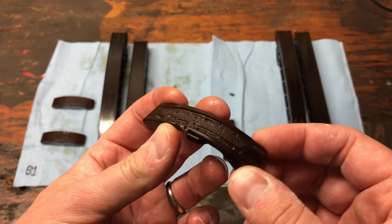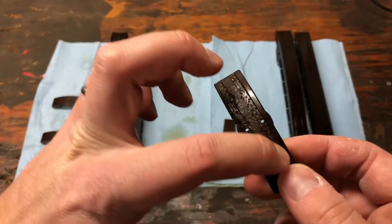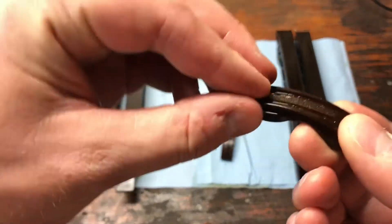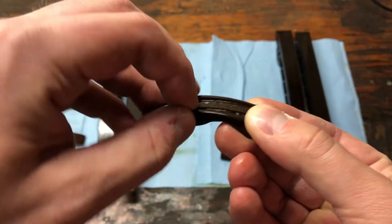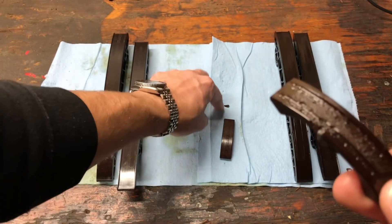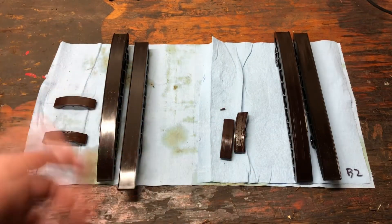There was some significant pitting going on here and this guide did not have much life left in it. It does make me wonder how much longer I could have run this before it would have completely disintegrated. But as I mentioned, once this top layer begins to wear away, sharp edges created by the pitting and the softer material below the top surface, it just starts to get eaten away at a much quicker rate. And then interestingly, I noticed this large chunk out of the guide — and I found that actually in my oil pan when I was draining the oil to do this entire project. As you can see, this piece perfectly fits right here. Pieces like that — this happened in the last 3000 miles, this huge chunk out of here, because last time I did my oil change, obviously this huge chunk was not there. So this thing was starting to deteriorate at a very rapid rate. And I'm very happy and thankful that I am doing this job now and not waiting any longer.